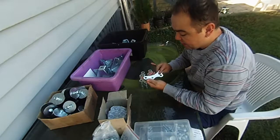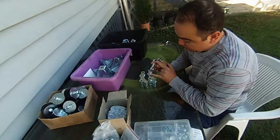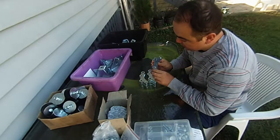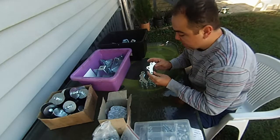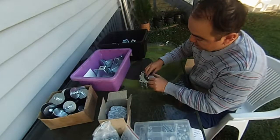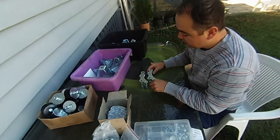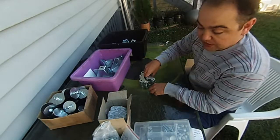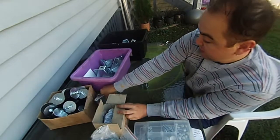So these are my R31 front brake adapters. You can see that two are through holes at 100 and two are tapped holes, M12 by 1.25. I think it's like 88.9 mil spacing, so you can put 4 pistons on R31s and stuff. Don't usually do anything with them other than just sit them on the shelf and then piece them together when I sell them. So I'll just put these out of the way.